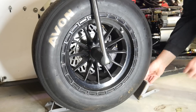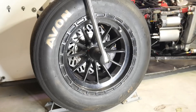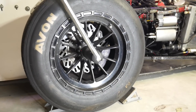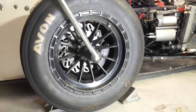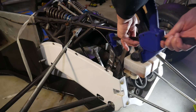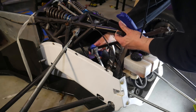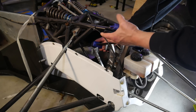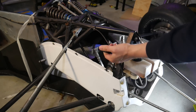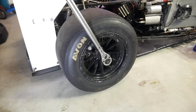We always try to start with simple solutions, so what about putting ramps either side of the wheel so the whole car can't roll? Unfortunately, the amount of torque required to tighten these nuts was way too much — the whole car will ride up the ramp and fall off the other side, so this one's a no-go. There is another solution that actually works quite well: introducing a clamp between the brake pedal and the front of the chassis. It's a little awkward with the brake fluid reservoir in the way, but we can successfully simulate someone pressing the brake pedal and holding it in to stop all of the wheels from turning. As a proof of concept, this was quite effective — I was able to torque the rear nuts up to 350 newton metres successfully.